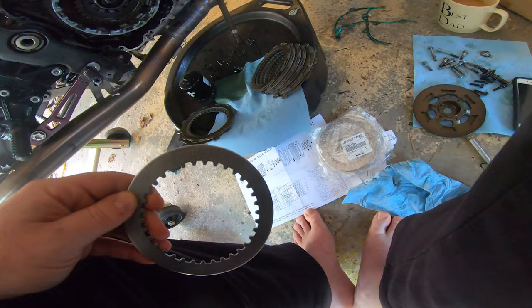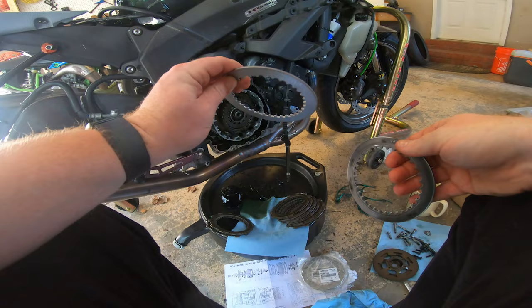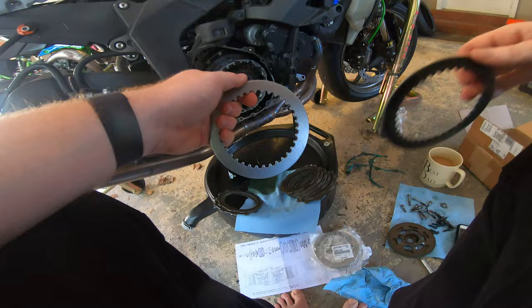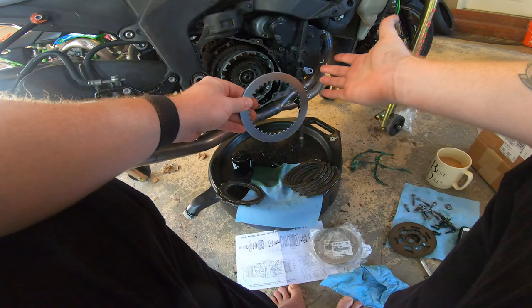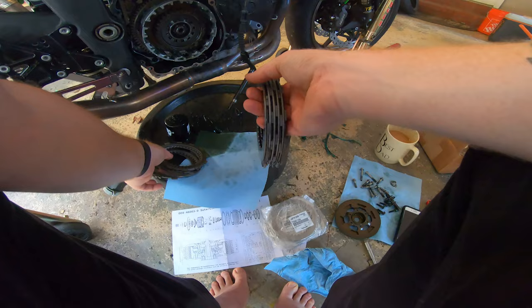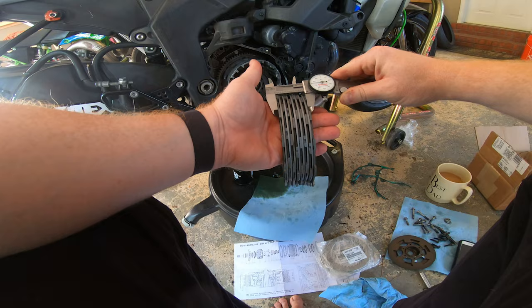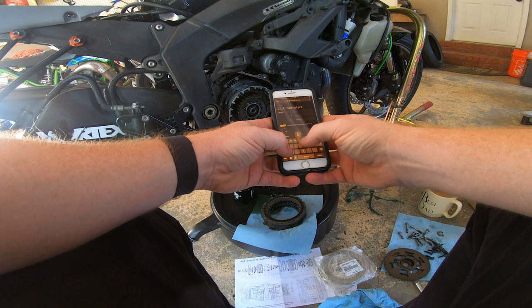Another thing — if you're paying attention, you'll notice this steel has these little dimply things on it, whereas the other one is just clean and smooth. That's something they did on the 2019 and newer clutches, so I like these better. Also, you know how they say they've got a rolled edge and a sharp edge? I put them in with the sharp edge toward the bike, all the same way — somebody correct me if that's wrong. So we took out the thin 2.3mm steel and put in the 2.6mm. Measuring again: 1.575 inches — consistent all the way around. That converts to 40.0 millimeters.